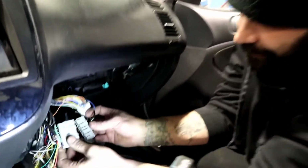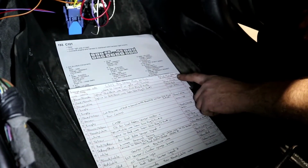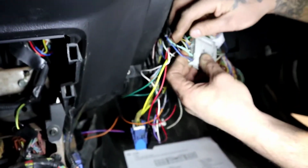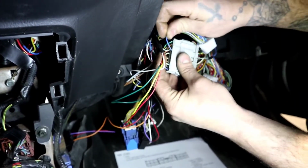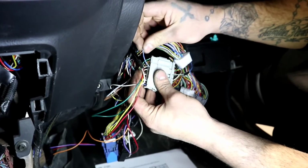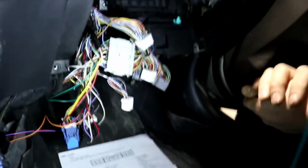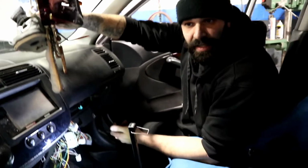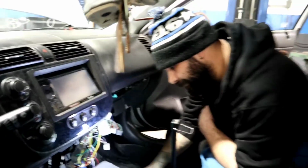All right? That blue-yellow wire, if you follow it, connects on the body side of the car to a blue-white wire. So let's go find it. That was number 6. What do we have here? A blue-white wire. What this wire does is it goes all the way through everything here to the cluster, and it actually gives our speedo the reading that our transmission is transmitting. So that's what that wire does. Let's move on to the next one.